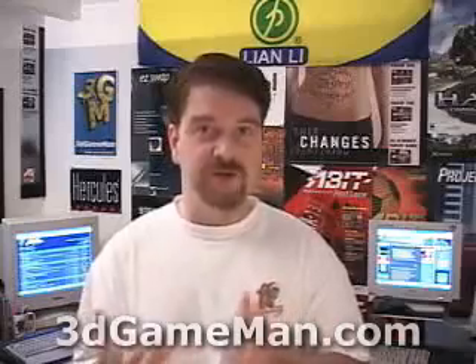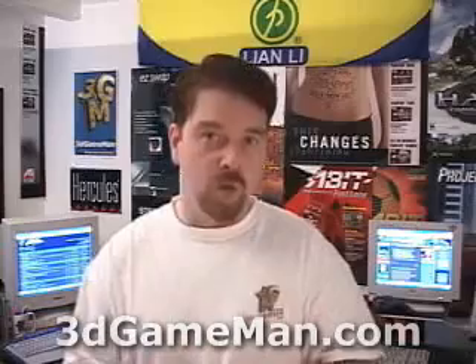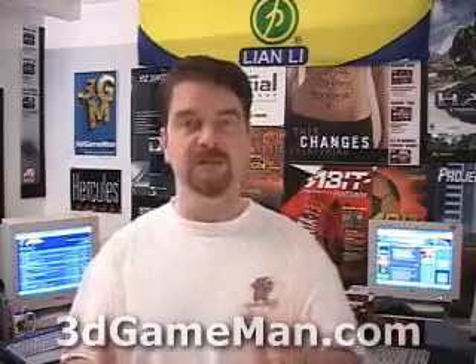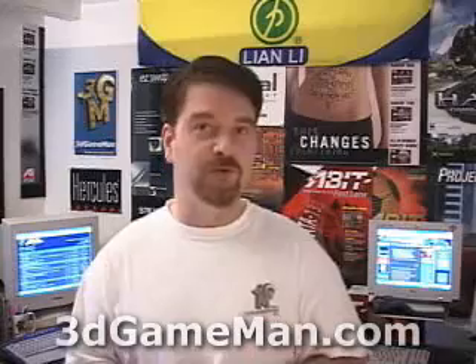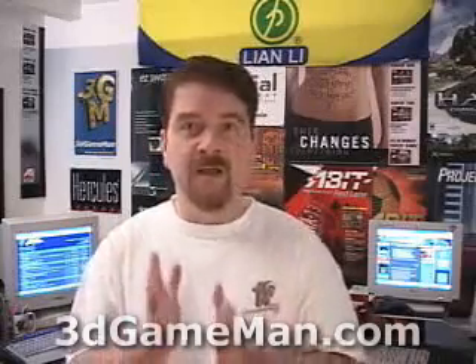As I've shown you, this kit is pretty simple to put together. You can find more information on installation procedures, testing, and recommendations on their website. As for why you'd buy a water cooling kit — low temperatures is the big thing. I was using an AMD Athlon 1800 at 2000MHz with a voltage of 1.85V and got a result at max load of 28 degrees Celsius — that is fantastic.